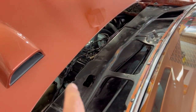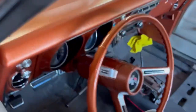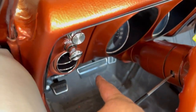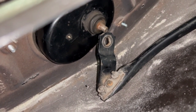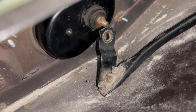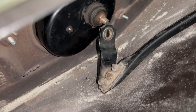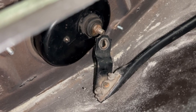Before we put all this back together, I need to verify the wiper motor is in park. Quick simple check — the wires are all hooked up, the ground wire is good. Reach in, turn the key on, and operate the wiper motor. Watch that motor spin. Turning on to low — okay, there's high. When I turn it off it'll turn a few more degrees and stop. There's off — and a few more degrees. I'll go low and hit off — there you go. That is definitely the park position.